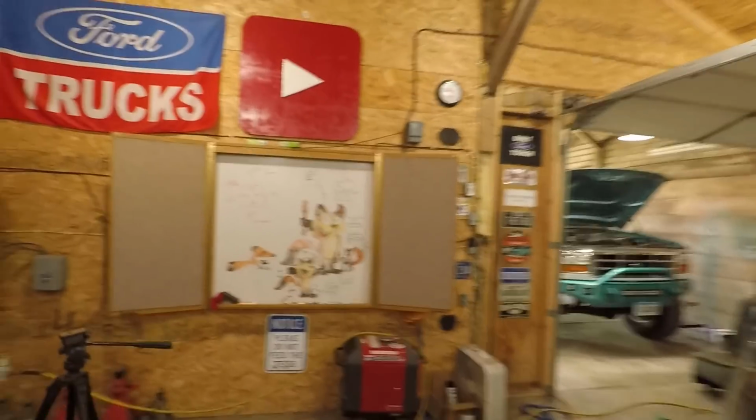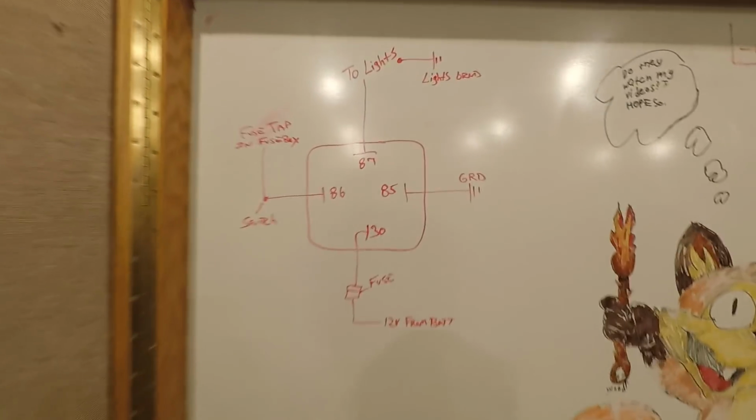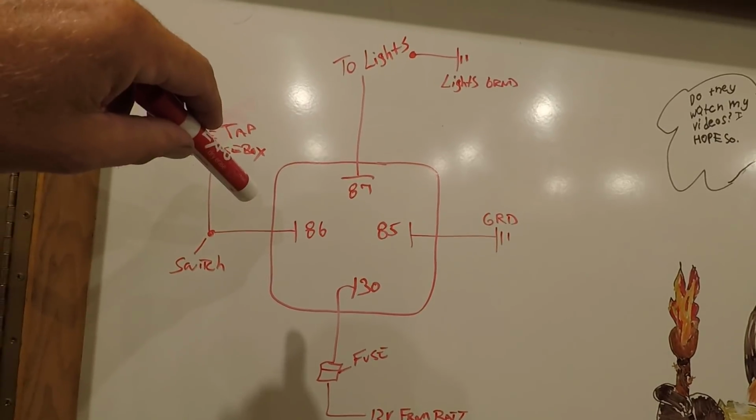And like I said, in my next video, I'll go over that a little more in depth and show you all the bits and pieces and how I'm doing this and why you should do it using relays. I know some people, they've done it without using relays. They just connect hot and ground to a switch in the cab, and you really don't want to be doing that. And in fact, most switches probably won't handle the current that you need to run a light bar.